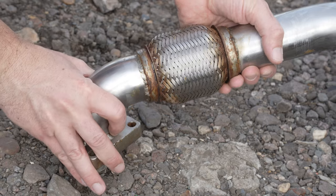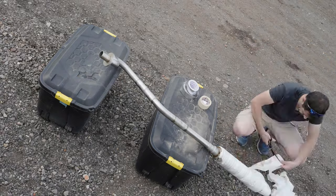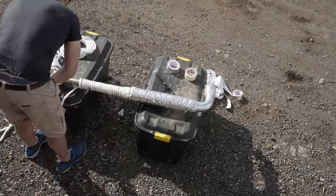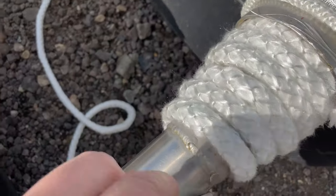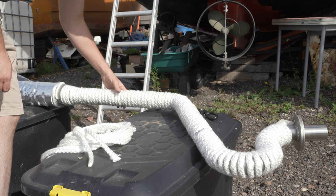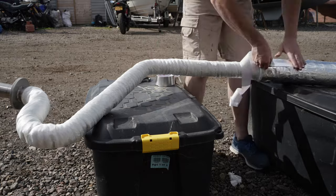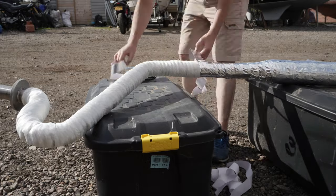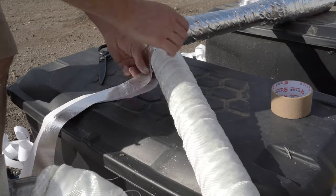I thought I'd quickly show you the newly welded flange and the wiggly bit. Then the dreaded lagging job. I investigated a number of higher tech, more exotic and certainly more expensive ways to lag the exhaust, but I've stuck with glass fibre. The pipe is stainless so can handle a little moisture if the glass does get damp. But since Alan is to be fired up and run much more often than in his previous life in service as a lifeboat, high temperatures should see to that. The first layer is braided glass rope — a thinner one over the silencer as it's already lagged inside — and then a thin glass fibre cloth to tidy everything up. I'm also sealing the whole lagging bonanza in a foil tape with a special high temperature adhesive, to keep everything neat and stop loose glass fibres from escaping and getting all over everyone and everything, and to give it a wipe-clean surface.